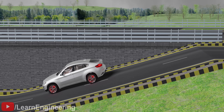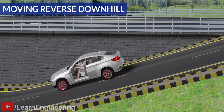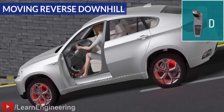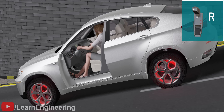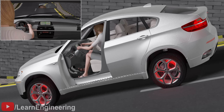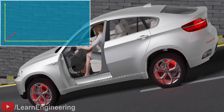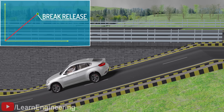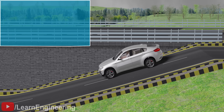Consider this situation: the driver wants to go in reverse when the vehicle is stopped on a downhill slope. Moving in the reverse direction while going downhill is more difficult than moving forward while going uphill, because in addition to the brake and acceleration pedal switching, you also need to consider the back view. Here, HSA will hold the brake for you while you look in the rearview mirror, and will hold it until you apply a specific level of pressure on the throttle pedal. Once sufficient torque is generated, the HSA will be deactivated.